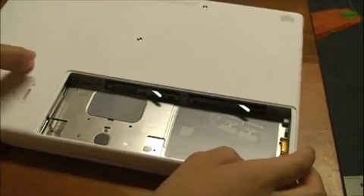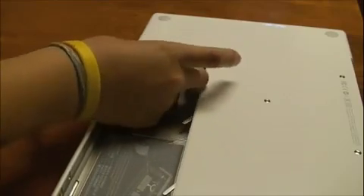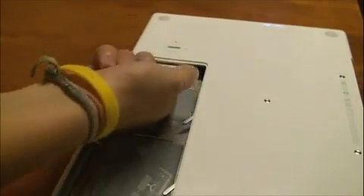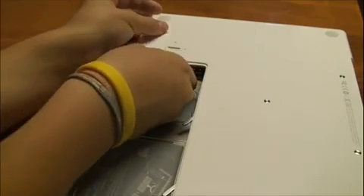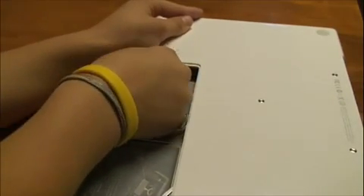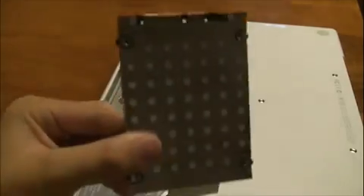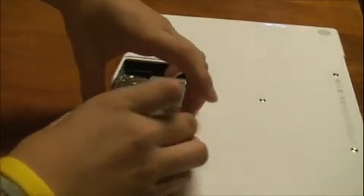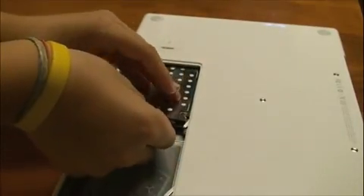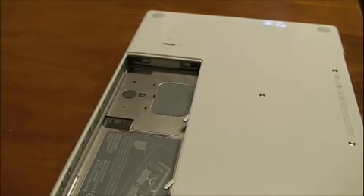While I'm here I'll show you the hard drive. Let's switch the camera. There's just this white tab. I wouldn't recommend just playing around with your computer like this, but just don't do it unless you need to, because something could go wrong. You're gonna pull really hard, straight out and straight back, so you don't hurt it. And that is the hard drive. Just make sure it's all the way down there, fold the white flap back under it, and push — not too hard, because it goes in fairly easy.